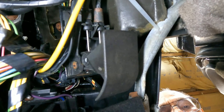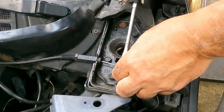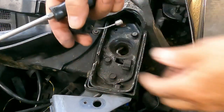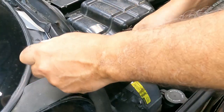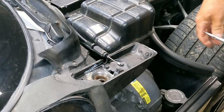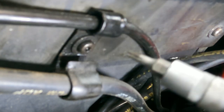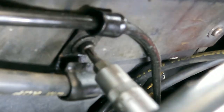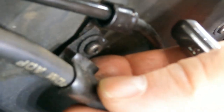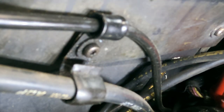Hopefully you can see that — that's where those two cables hook up. I'm going to disconnect the cables up in the engine compartment and see if those will pop off. Hopefully you can see this — basically this clip just bends up. I'm going to pop that off first, then pop the other one off — yeah, that made it a little easier. There are at least three T-15 torx bolts that need to be removed. You don't need a ratchet — a regular T-handle works fine — but they need to come off in order to get this cable bracket off.